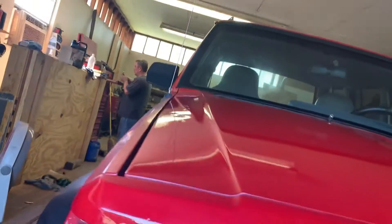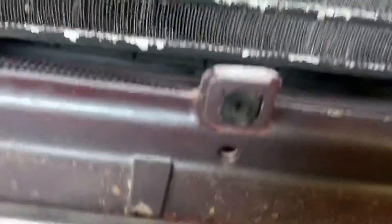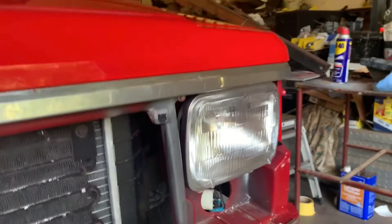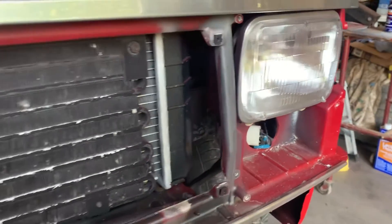Got the new hood put on - yes, it's got a couple little hail dents in it, but got it fitting pretty good, all pretty even. We did break the cowl because it was hitting the hood, so just got to find another cowl - no big deal. Also put all new ones of these in that we got off the old grill off of this Jeep, and put the grill back in, the corners, the headlight bezels, and all that stuff. He's still working on getting the fuel pump locked in, and I'm hoping by the end of today, Saturday, we can get this thing rolled outside.